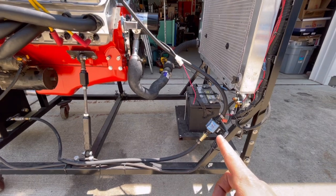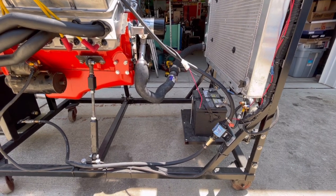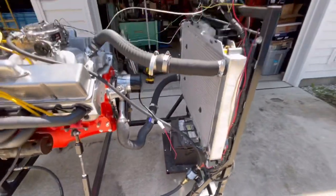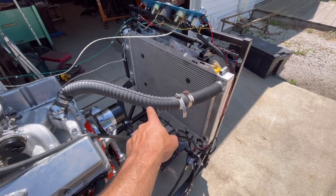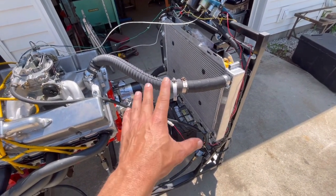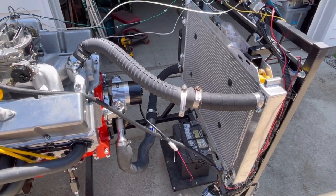This does have an electric fuel pump. The reason we did that is for ease of use — just in case somebody doesn't have a mechanical pump with their system, we can hook it right up. That is self-regulated, which is important so you don't overfill the bowls. Now talking about cooling — like a normal radiator it's got your ports on there, but every engine is different. So we have different hose pieces that we can combine for different configurations. It might not look the best, but it works. This isn't about appearance, it's about functionality.